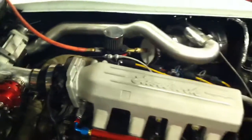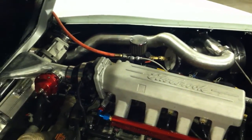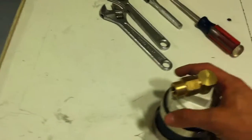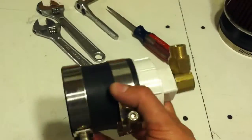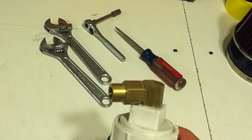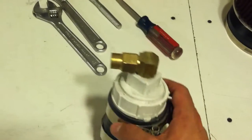That's a good way to test for boost leaks and track down their location. Another good method would be if you had your pipes separated — use a straight coupler, something like this with two clamps, maybe some kind of PVC piece in there to clamp up, and use the same pressure regulator setup in the same fashion.